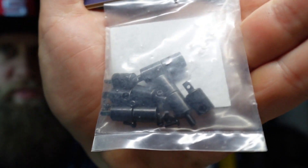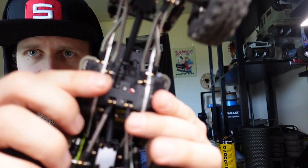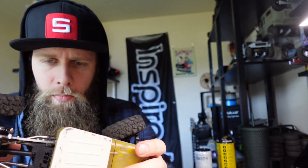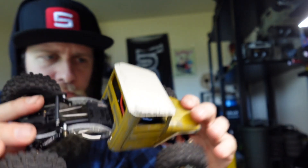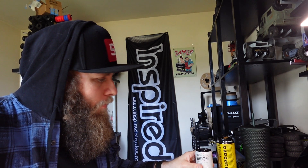Here's another thing — a drive shaft extender. Let me show you one that's not attached. I got these on Amazon; there's a ton of them. I have mine attached to the transmission and then my drive shaft attaches to that, and that helps raise the drive shaft. Instead of the pivot point being immediately off the transmission, it puts the pivot point back more and raises it. I really had no idea what I was doing — I was just playing and trying to get as much clearance as possible. The way I learn best is just do it, then go try it and see how it affects the truck.